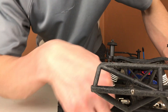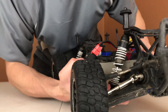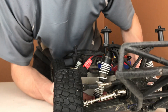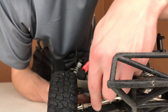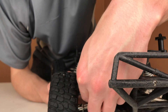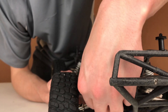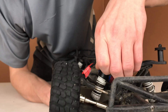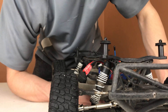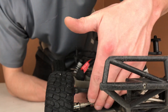Ever since then, this has stayed together really well. They're telescopic and very similar to the stock ones in the way that they work. They have a U-joint just like the stock ones, so it's not a constant velocity. It does have splined outer and inner shafts to accommodate the telescoping action. That's a pretty typical style. They look really good — they're nice and shiny still.